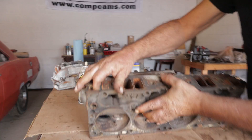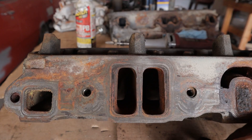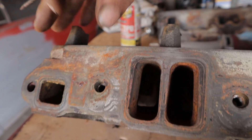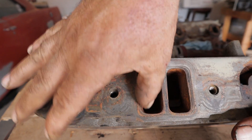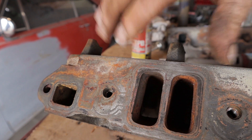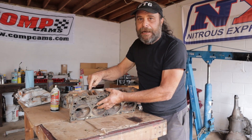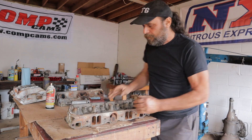When I say smooth it — if you run your hand in here you're going to feel all sorts of little casting flaws, little ridges that pop up. Don't worry so much about texture; worry about things that aren't part of the smooth casting — sharp edges like this one right here, and as you go inside you'll feel little bumps. So I'm going to dress this port out and I'll show you the result and point out what I did with it.